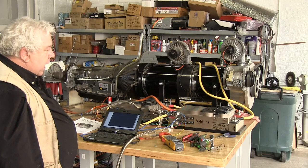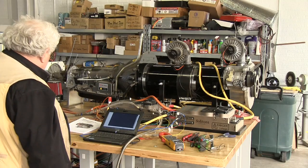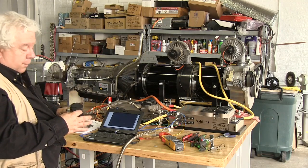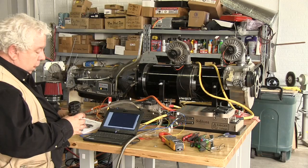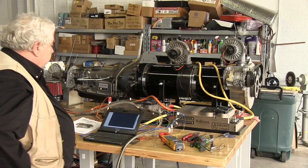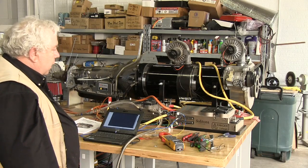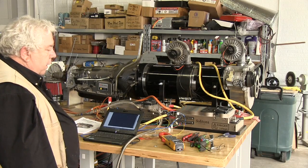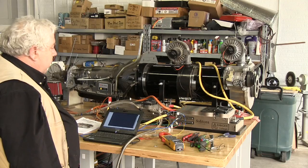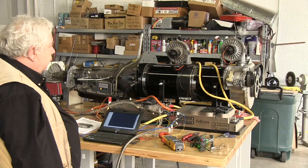And so that's what we're looking at for now, is operating two Solitons, two motors, using our throttle position sensor from the cable system that connects to here. We found the drawing. We know what pins are which, and we're simply stealing that signal to use as a throttle. We have our tach signal from our Cherry system now to our Solitons, and we've got the software upgraded. We're going to have to upgrade it again to get that start signal working, but my sense is all this is working very nicely to suit.